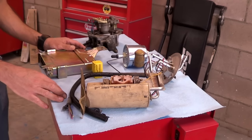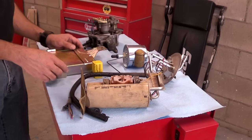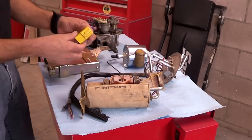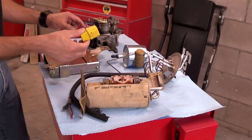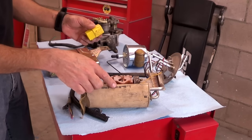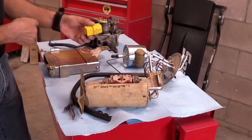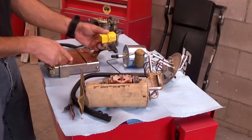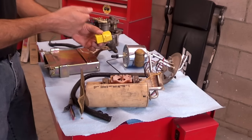To break it into more detail, some of the things that apply to the multi-port fuel injection system will apply to the throttle body unit. One of them is that the engine control computer itself will not send direct current to the fuel pump. On a relay, you have a wire that goes from the relay to the main fuse box panel — that will have enough amperage to operate the pump. There's another wire going to the pump itself through the harness, a ground, and a signal wire that is a smaller diameter wire going to the computer. This small wire from the ECM to the relay activates it when it receives the signal from the ignition system.